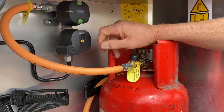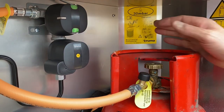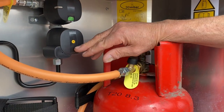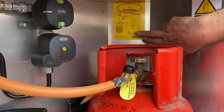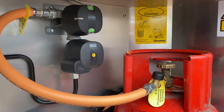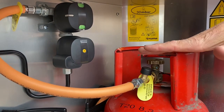This thing here is a crash sensor. With this system you can travel with the gas turned on. If there's a problem — a pipe rupture or anything — that would shoot out and stop any gas escaping further than the bottle. To reset it, you just push the button in and hold it for 10 seconds — that will reset the gas. That'll probably never happen. So from your point of view: valve on, button on, and you've got your indicator to show which bottle you're using.